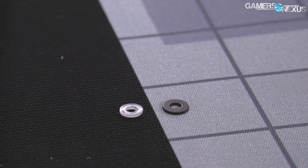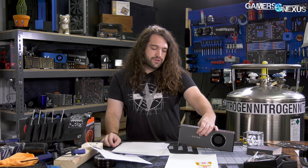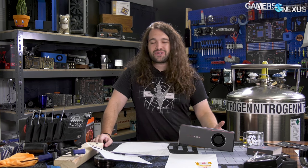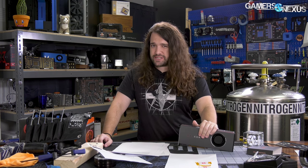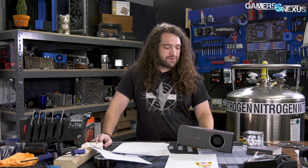The final recommendations: we used a one millimeter thick steel washer and that worked fine — just watch the torque on it. We used Hydronaut paste, but would recommend Cryonaut or something similar. For your uses, I'd probably recommend a plastic washer that's a little bit thinner — 0.7mm would be ideal. The improvement is worthwhile. We went from 40 dBA and throttling, which is not a valid use, to 40 dBA and not throttling. So you can actually use the card at 40 dBA as tested 20 inches away in a room with a noise floor of about 26 dB. That fixed a lot of the problems with the cooler in terms of not throttling while being at a reasonable temperature.